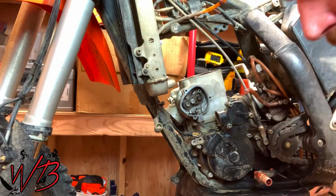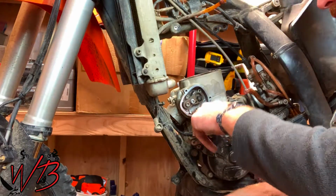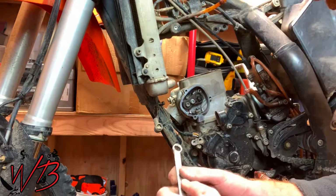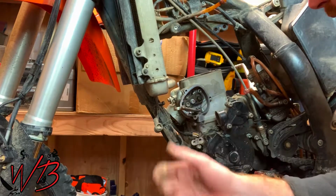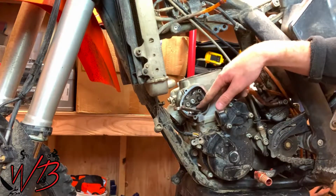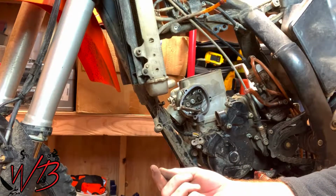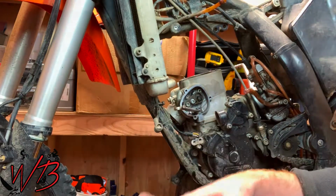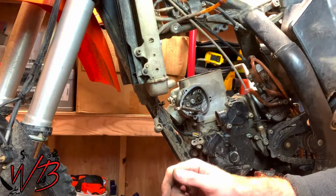It's the same exact process loosening the cylinder base bolts. These are studs. So just go ahead and loosen these about a 1/4 turn on each one in a star pattern. So corner to corner and then corner to corner again, and then go through again and do another 1/4 turn, and then you can go ahead and just unscrew them. That'll release the pressure as evenly as you can and keep anything from getting distorted at all.